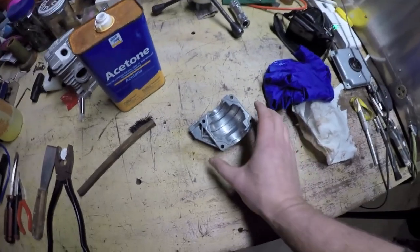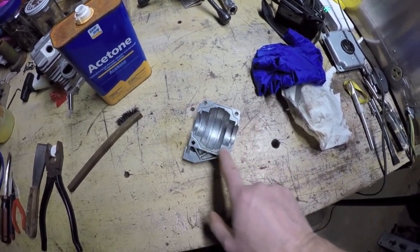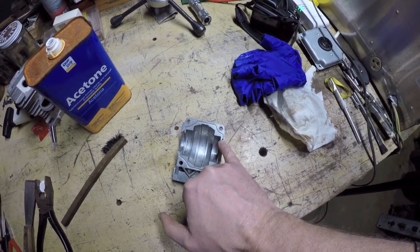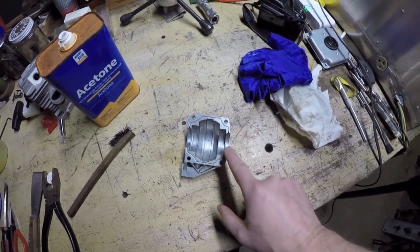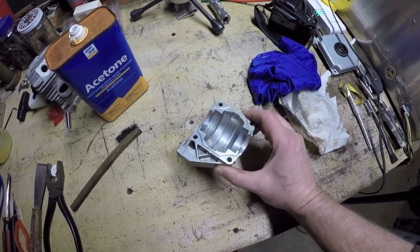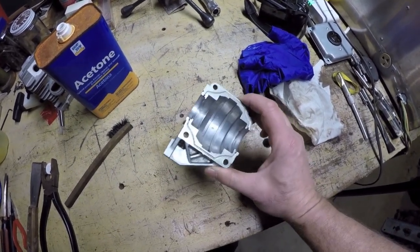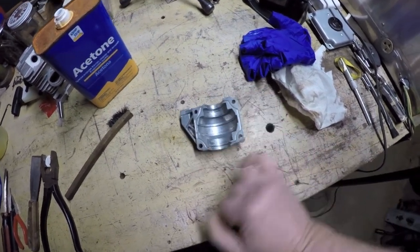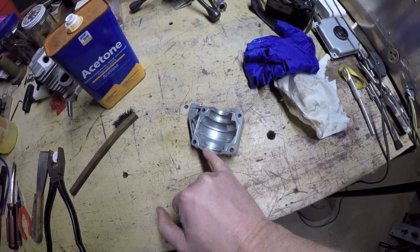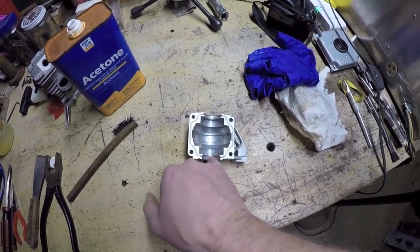Time for some reassembly. The first thing I need to do is clean up the bottom half of the crankcase and get all of the red sealant off of here. I'm going to use a small dental pick tool to clean out this groove — the sealant fills that groove and spreads out a little bit. There's no gasket; it almost looks like there should be a seal in there but there was none when I took it apart. I think this is actually factory. There was a little bit of sealant residue in the seal bore surfaces, but I think that was just incidental spillover.